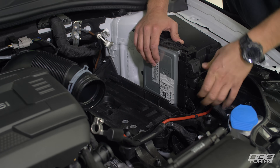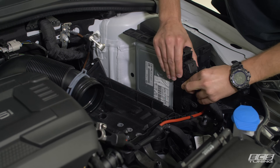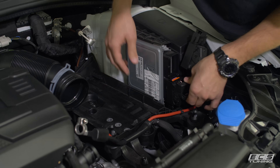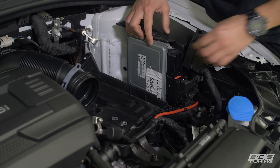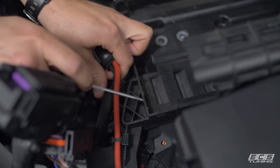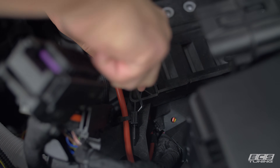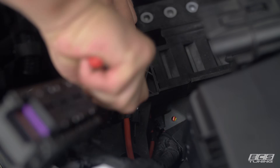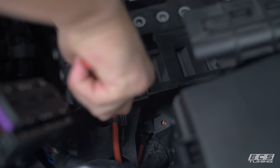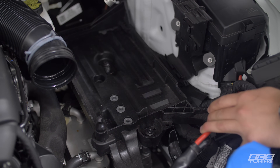All you have to do is pull back on these little levers and they will release the connectors. Work that out — it's kind of trapped in there. To get it out the rest of the way, we'll just lift up here. We need to get the positive cable off of the battery tray. There's a little fir tree down there — give it a quick tug up and then release this clip with a pick. Now that we've got the positive cable out of the way, we're going to remove the battery tray.